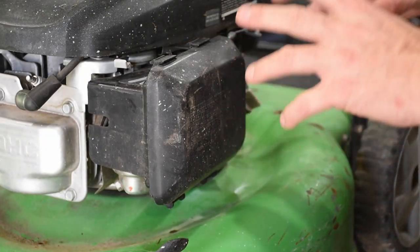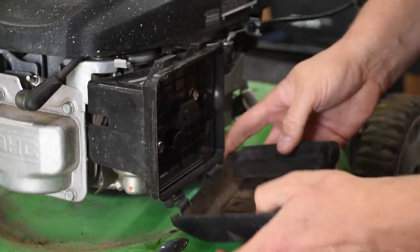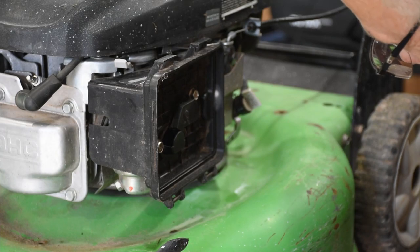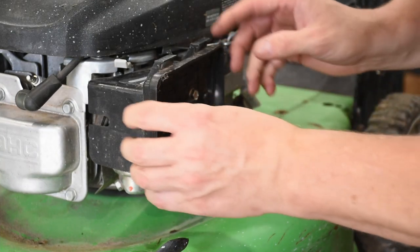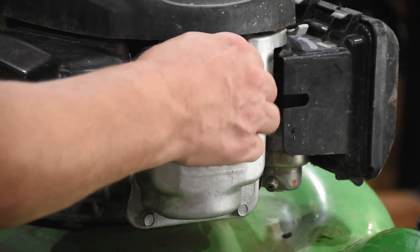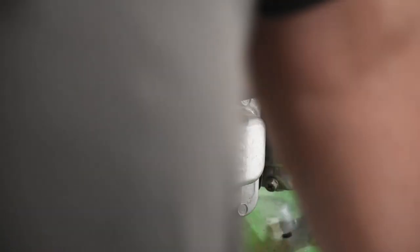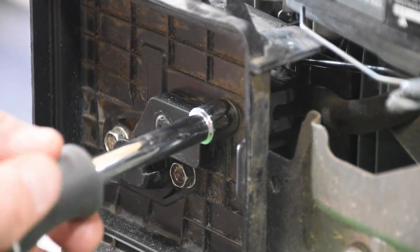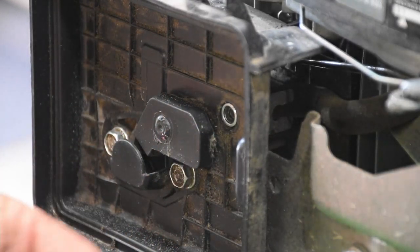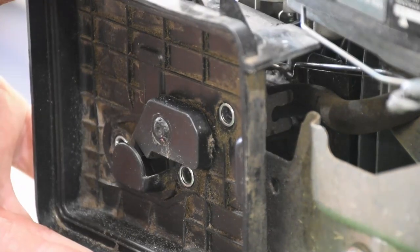When I started this machine it was really surging quite a bit, so I think we'll take the carburetor right off and give it a thorough cleaning. The carburetor sits underneath this plastic shroud here, but before we can take that off we need to do a simple safety step — take off the spark plug. This means if you do happen to bump the machine with the blade on it can't start; you've isolated the power. Next we're going to take out these three bolts: this short little one just holds the plastic shroud, but these two longer bolts actually go right through the carburetor into the engine block.